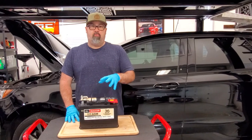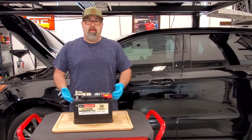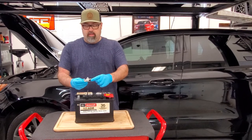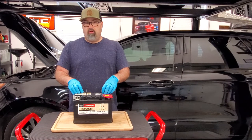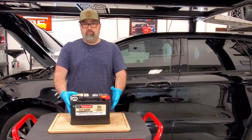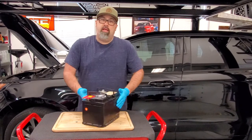We've got our battery exchanged and we had to have the old battery for a core. The battery we decided to go with is a Motorcraft AGM battery. AGM stands for Absorbed Glass Mat. The reason why I decided to go with an AGM battery is that lead acid batteries can make a mess and cause corrosion over time — everyone's probably seen the green corrosion that comes up on battery posts. AGM batteries eliminate that issue. I did check and the black clamp on the negative side fits great. This is actually a Ford-recommended replacement for the original battery. The part number for this battery is BAGM-48H6760, and I'll put a link down in the description below.